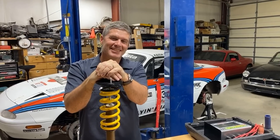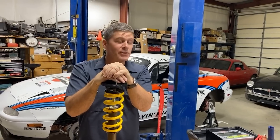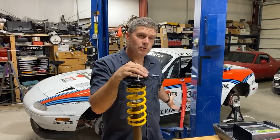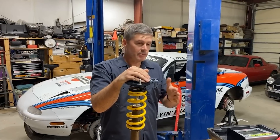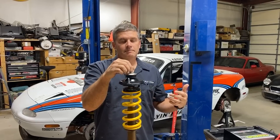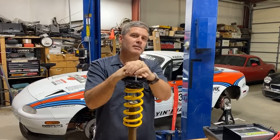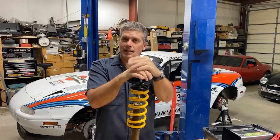Question: if the owners of the car are multiple drivers with an extreme couple-hundred-pound weight difference, should they take that into account when corner balancing? If you have access to scales, I would throw those different people in there. It's unlikely to make a massive difference — it will change how much weight is on each side, but the diagonal distribution, because of where the driver sits in the Miata, is unlikely to be enormously affected. If you're going for that last one-tenth of one percent, you may have to accept a halfway situation where you're fifty pounds off for both drivers.